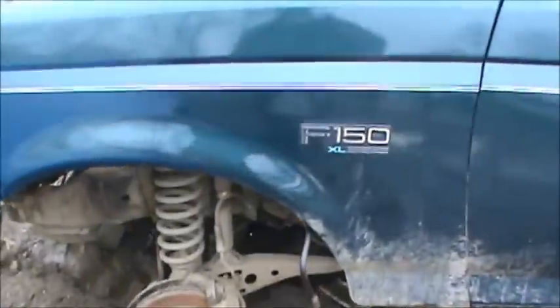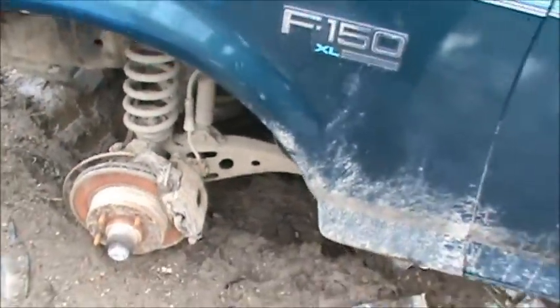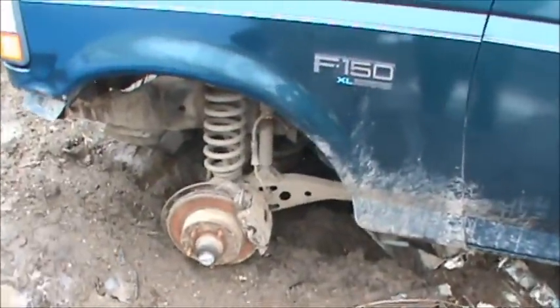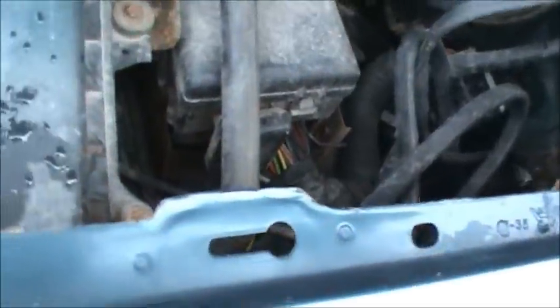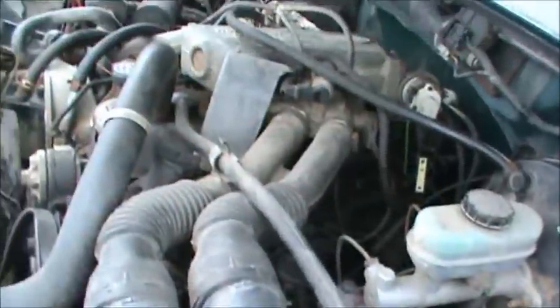For this new style Ford pickup, you sneak in through here, peel back that fender inner plastic down there, and then you can get a look at the ECM and read it — that's F3TFzb. That's how you read those without even taking them out. The tire being off helps greatly. Then I just take the 10mm and bust those two nuts off and pry it out with the fender inner plastic pushed down — and that's how you do it.